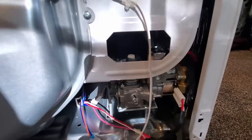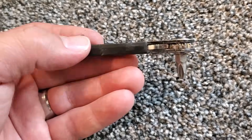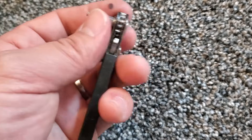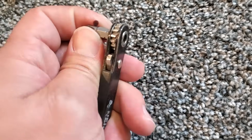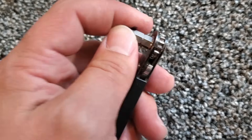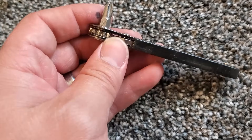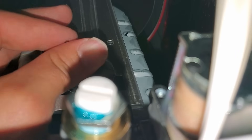Now right back in here, behind the gas valve, we should be able to see where the burner is. You can see that single burner there, and we have to remove this screw and this screw. It's kind of tight back in here. This is the tool I used to remove those two screws — just a little right angle ratchet tool that fits the quarter inch nut driver size, and it's also set so that you can't push it through to the other side. I'll try to link to one of these in the description. It's a very handy right angle tool. So the screws are out and we'll go ahead and slide this forward and lift it out.